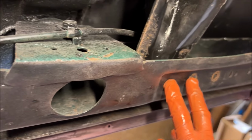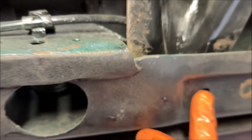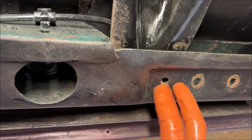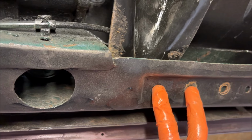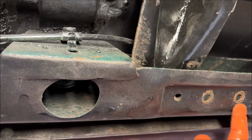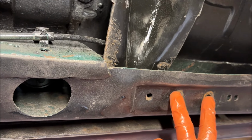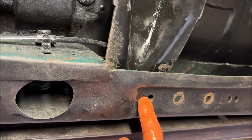There'll be a 3.75 inch offset. So see the front bolt hole here, this is 1.75 inches. So I want this front bolt to go to here. No, I want this front bolt to go to here. So that's a distance of 1.75 plus 2. So that's 3.75 inches that this crossmember is going to move. The reason for that is that means that the back hole will be here and the whole crossmember on a flat part. Then what I'm going to do is I'm going to widen it. I can either widen it to the front or the back. Doesn't matter. Maybe I'll just go to the back.